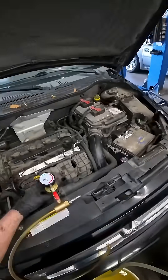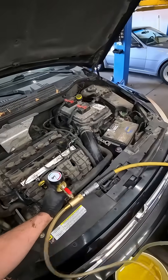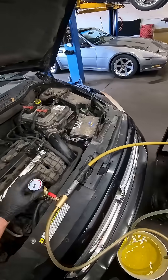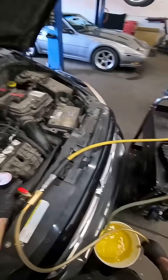What we're going to do is put this thing under vacuum using this vacuum pump here, and we're looking for about 26-27 inches of vacuum on the system and for it to hold good vacuum before we fill it up.